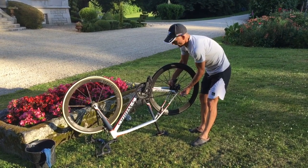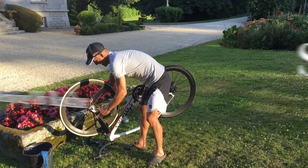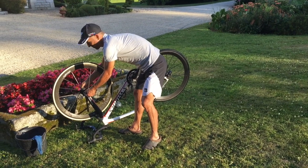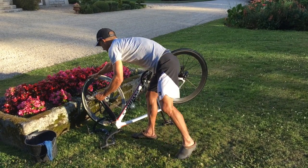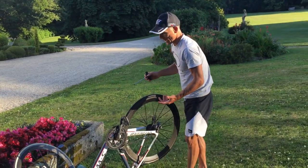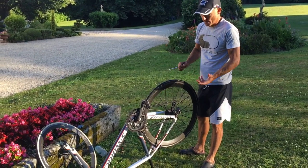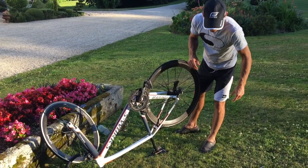So the next stage — I find it much easier if you take the wheels off, just gives you better access to everything really. The point is basically: don't spray your bike all over with degreasing products. You don't need to buy expensive products and you don't need to spray your bike all over with degreasers, because what happens is they will eventually work their way into the bottom bracket, the jockey wheels, down cables, and you don't want to be stripping the grease off your bike everywhere. Long term, it's not going to do your bike any favours.